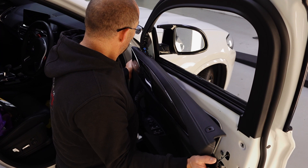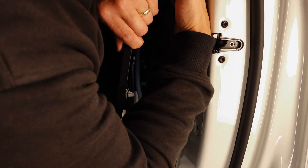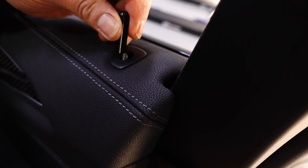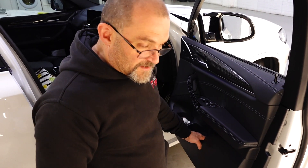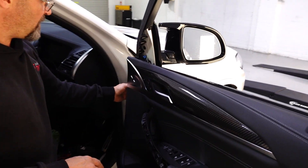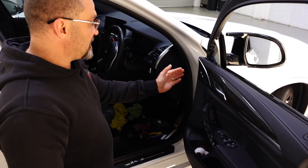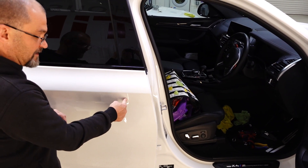When you're putting it back in, all I usually do is just hook the nose in first, then lift that pivot on there, slide up the rod and feed it through the hole. Then just put the door lock on and wind it on a couple of turns — that way it'll seat in there and won't keep dropping out. If you have dropped any plugs that you need to fit in the back of the trim, at least now it's loose and you can get in behind it. I've found it's a lot easier when reassembling — there's a plug here at the front. Locate that plug in behind the door trim at the front, seat that in first and then tap the rest of the trim. Same goes for the rear door: do that inside plug first and the rest of the door trim will line up.